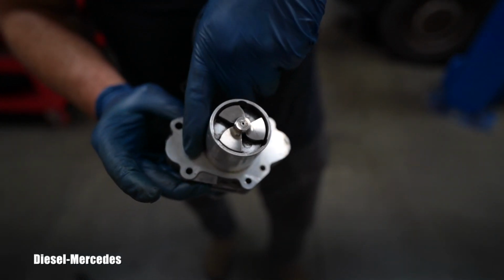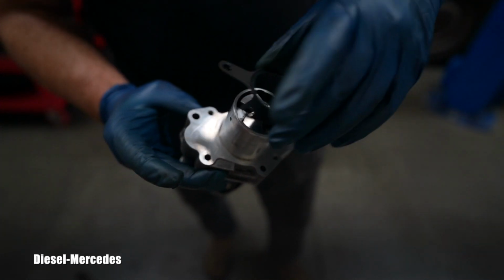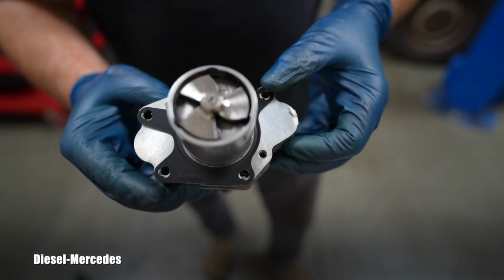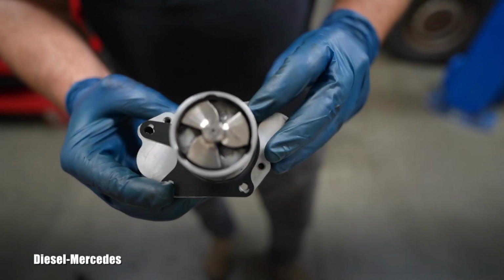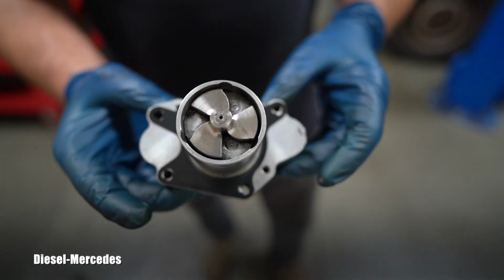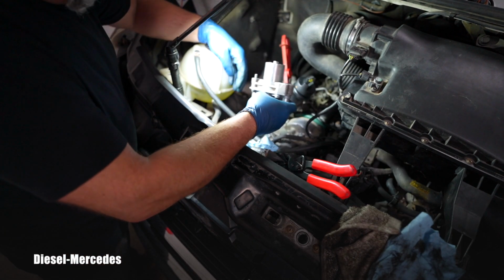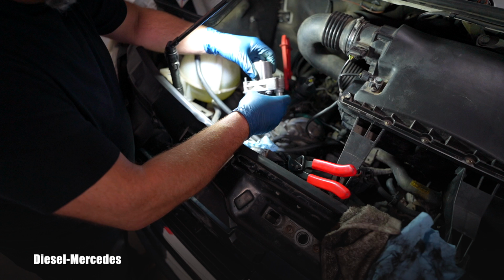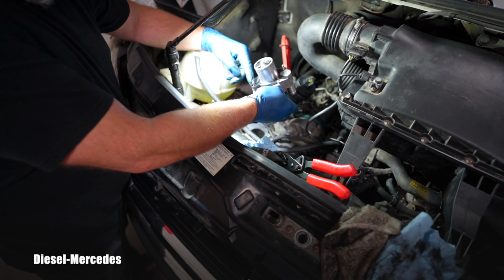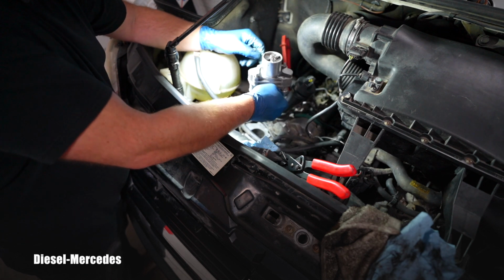You can see there are still kind of visible areas on the body of the EGR. So we know this is the correct position. So let's say if this is the electrical connector, this is how it belongs on it. So you remember how difficult it was to wiggle it out, after the opening is clean I pre-installed 2 of those bolts. The gasket is right here, the new one, nicely grabbing them, they will not move.